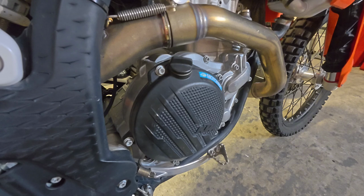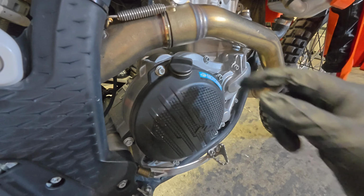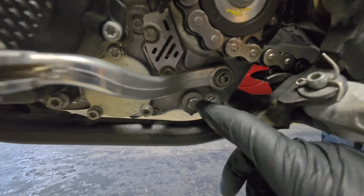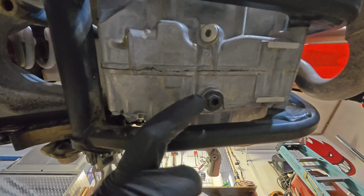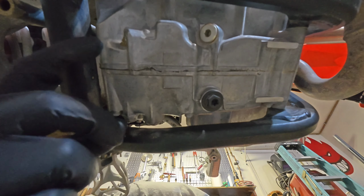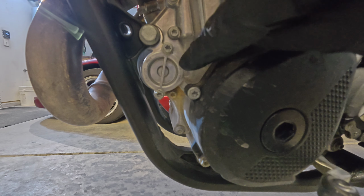Prior to draining the oil out of the machine, you need to first go around and clean the area surrounding the 5 plugs or caps that will be removed during this procedure. This includes the oil fill plug that you see right here, the magnetic drain plug, the oil screen cap, the screw plug at the bottom of the engine case. Do not attempt to remove this plug or this plug. And you have your oil filter cap.